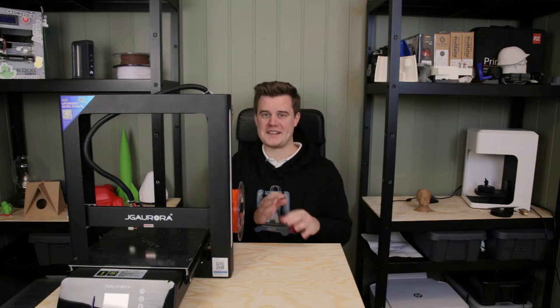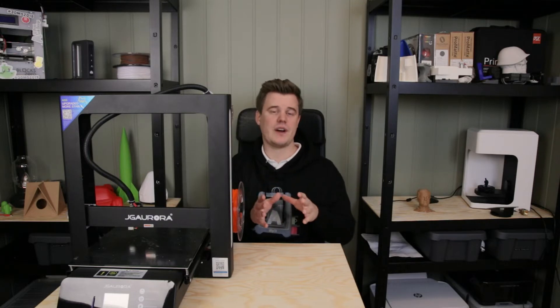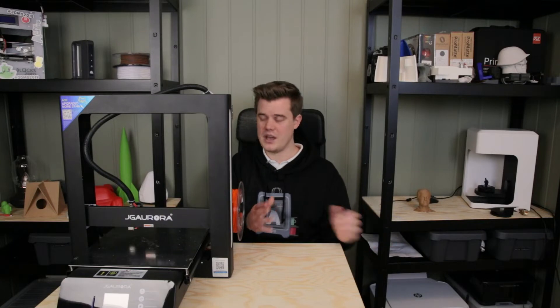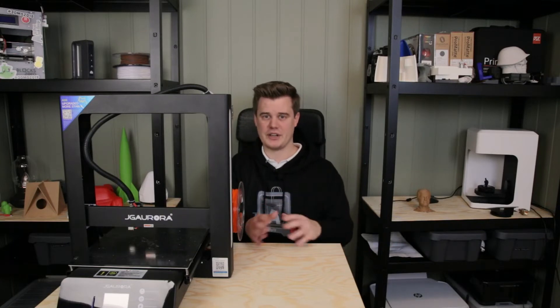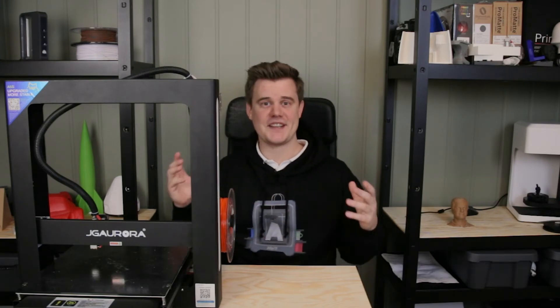A good organic oil or sewing machine oil — something that is very easy flowing and very light — is good. You don't want to use pure fat; that's too much, especially for the fans. They spin at a higher RPM, so if you can, try to find out which oil the fan manufacturer recommends, though that information is often not available. I'll show you how to lubricate your fan with a few tips and tricks.